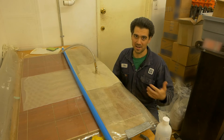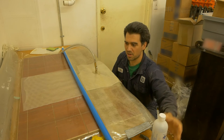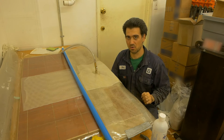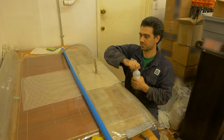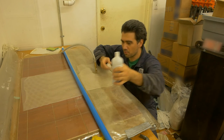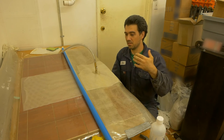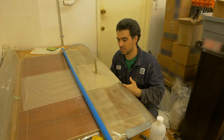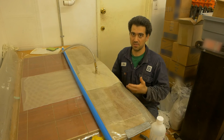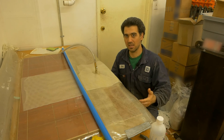That's why I rely on my next method, which is using rubbing alcohol. If I suspect a leak somewhere I just douse it a little bit in the rubbing alcohol — create a little puddle like this and spread it through the area. If there was a leak somewhere over there, basically the air pressure will force the alcohol inside the bag and that means I have confirmed my suspicion of the vacuum leak. The good thing about the alcohol is that you take a clean rag and rub it off — the area is cleaned immediately.